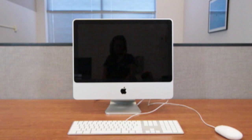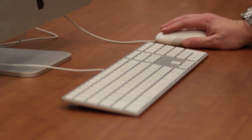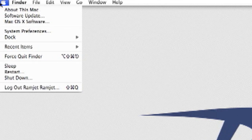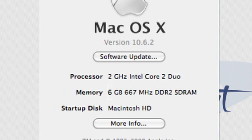Finally, start your computer. If your RAM is not seated correctly, it will beep at startup. After your iMac starts up, check that your RAM is being recognized correctly by going to the Apple menu in the upper left corner and clicking About This Mac. If the new RAM is not registering, repeat the installation process, taking special note that the RAM is seating fully into the slot.